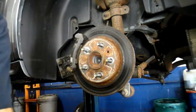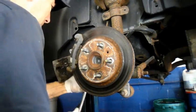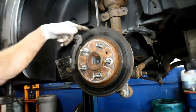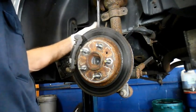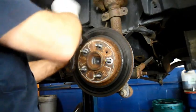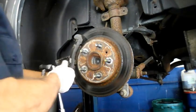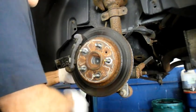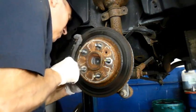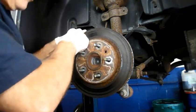That's a 13 millimeter mounting bolt in the back there — I'm going to break them loose. Now don't take them both out — just break it loose for now. Because if you take this bottom bolt out and you try to loosen this one, the whole bracket's going to slide up and out of the way. Break it loose, and once you break it loose then you can just take the two of them right out. Don't lose them because we're going to need to use them again. And we're just going to take this bracket off for now.